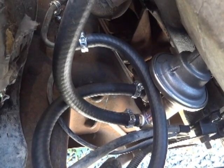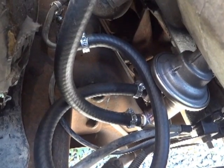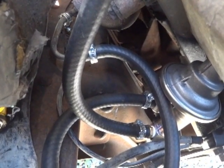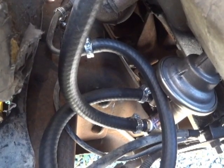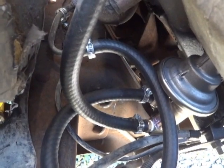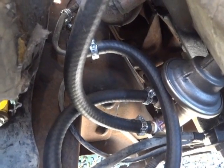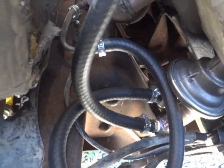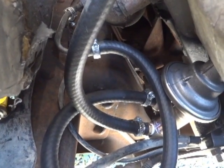The rear lines and the rear fuel selector valve — any one of those things can leak air. When you do this test it's much better to have your rear tanks full, so if there is any air coming from inside the lines or tanks, the lines will be completely submerged and won't be leaking.